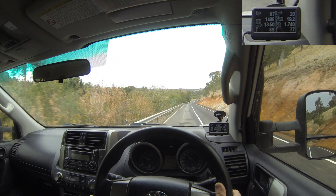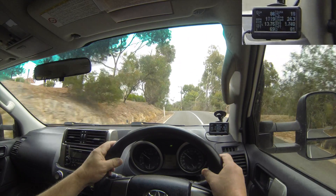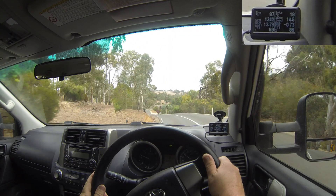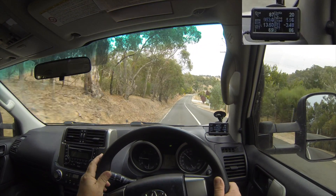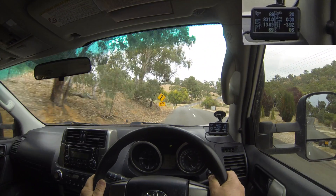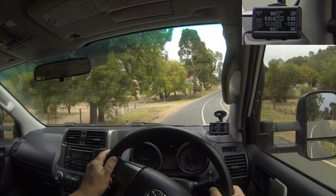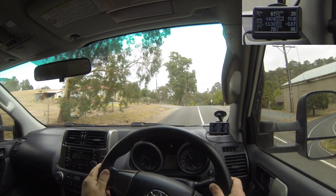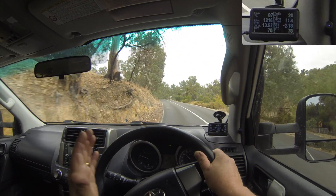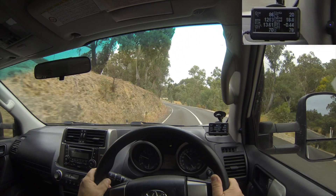It's completely fully automatic in operation - basically just turn it on and forget about it. Lock-Up Mate doesn't use a simple speed to control lockup on or off; those types of systems are prone to throwing error codes or causing the factory computer to throw an error code. Lock-Up Mate instead, because it uses all that information about what the vehicle's doing, actually works in harmony with the transmission computer. It hands control of the torque converter lockup from Lock-Up Mate back to the factory computer depending on the mode of operation and conditions. It's a very advanced, very intelligent control.